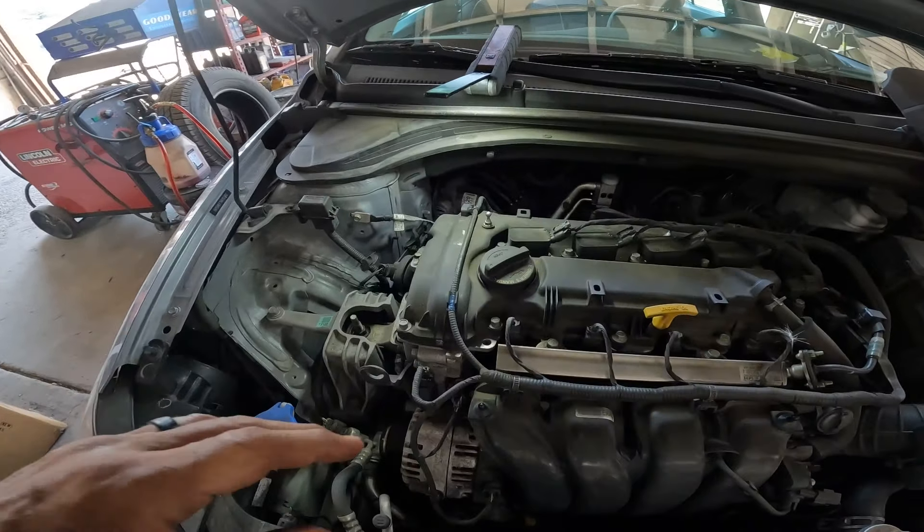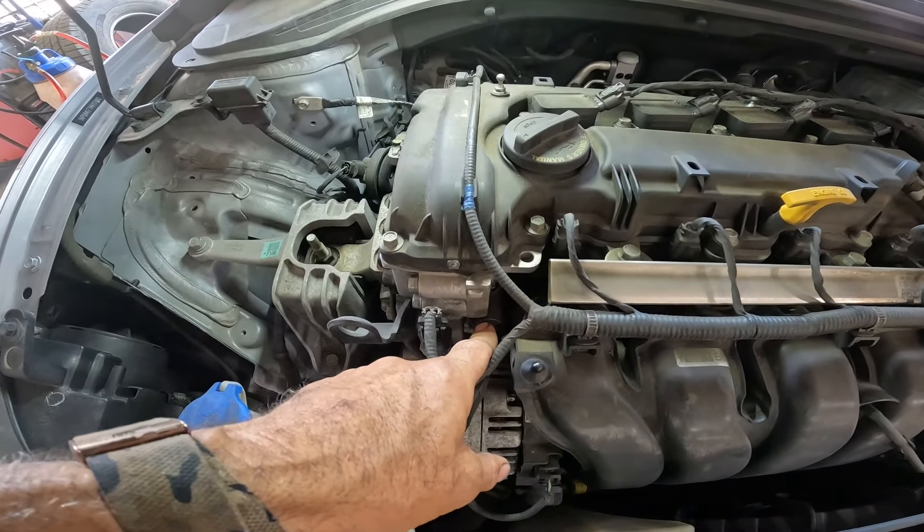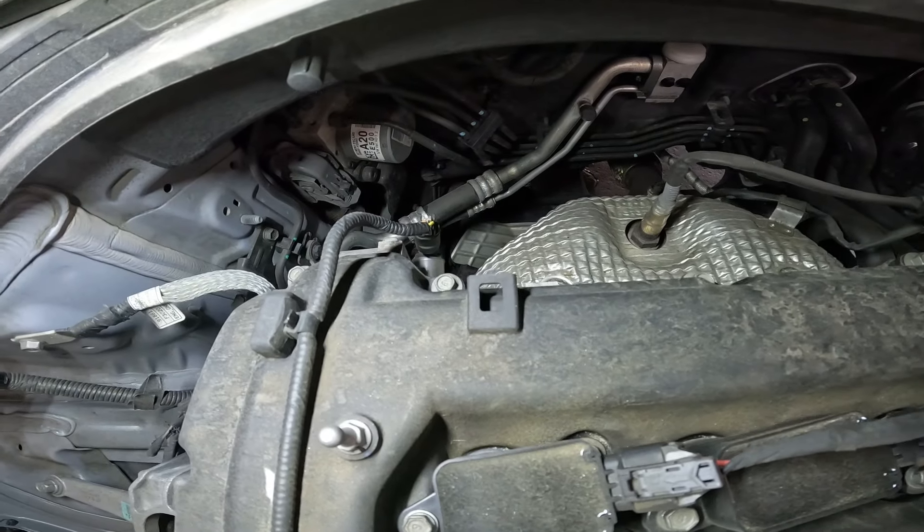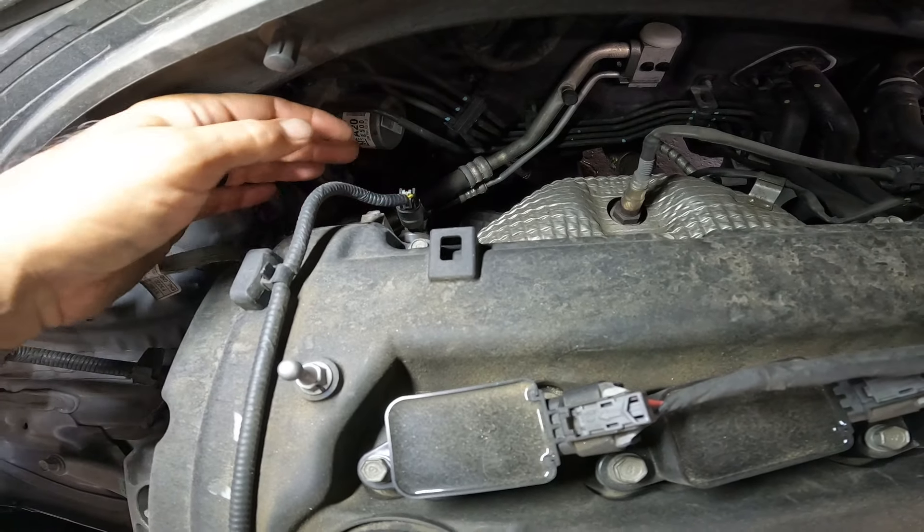After reading this, what I'm going to do is go out to the valve and check for battery voltage and ground at the connector. If that looks good, I'll apply battery voltage and ground to the solenoid and make sure it's working correctly. Like I said, I've seen it hundreds of times on these cars — most likely it's just that valve, but we're going to verify it anyway. Your variable valve solenoids are located here — this is your intake one and this is your exhaust one, which is the one giving the code.